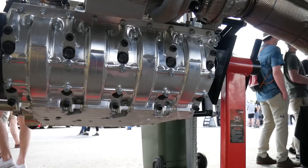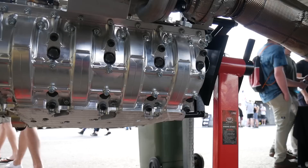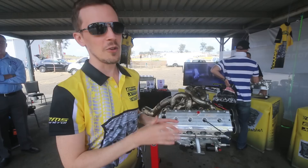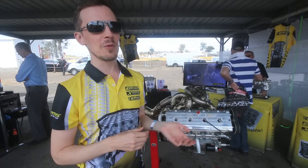We have a service cover underneath so we can get the connecting rods and pistons out with the engine in the car — the cover for that is also billet. We have the ducting for the dry sump oil pump, that's also billet, and the cover plating for that is also billet. The oil pump is an aftermarket one; they pretty much machine the parts so you could maybe class that as billet too. For low quantity production, to use high-strength aluminum you really want billet parts, because you can use stronger stuff than cast aluminum and it pays off.